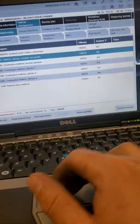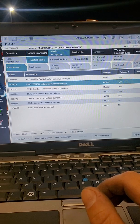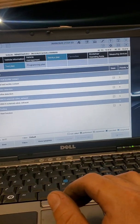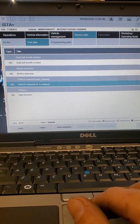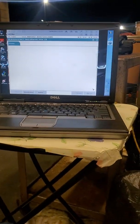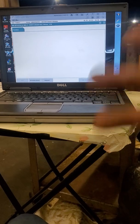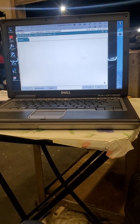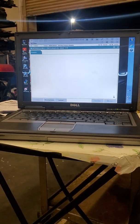It's unlikely that all three cylinders are misfiring. Okay, put the key on, engine off. We're going to do the ABL test plan for Vanos solenoid exhaust — and that's probably what's bad. So that's an electrical fault, you see. But that was up when I first checked it. And after I erased the fault codes, all these faults came back with that exhaust camshaft sensor. And that pedal position sensor looked kind of off too, but there isn't a fault for it, so I don't think anything's wrong with that.